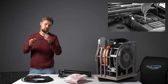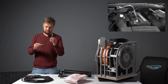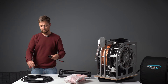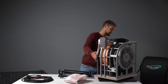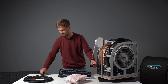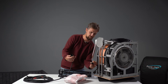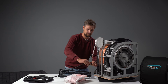For the spool we have two power cables — the plus and minus cable — as well as a short plus cable. On a daily-use car for winching, we leave the short plus cable connected to the car battery, so you just put the minus on your battery and quickly connect the main plus power cable. On the winch end, the cable connects here using a twist-lock system — spin the cables in opposite directions, find the good connection, and release.